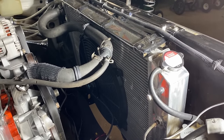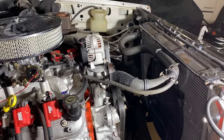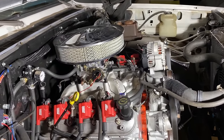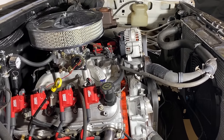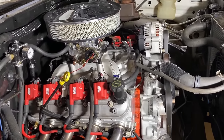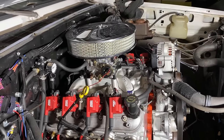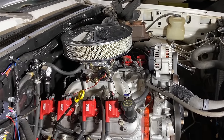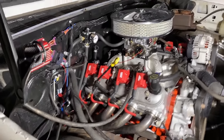If the truck is moving I don't have an issue; if it's sitting in the driveway idling I turn the fan on. I never have an overheating issue when I make a pull. As for the driveshaft — if it has no dents or flaws and you've replaced the U-joints, a stock driveshaft is fine. I ran one for a long time, but earlier this summer I didn't check over everything, the bell housing loosened up and ejected the transmission, which bent the driveshaft, so I had to have a new one made.